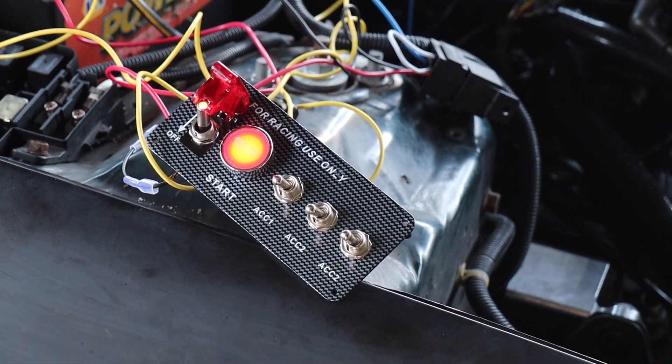I got all the lights to work when I put the switch on, but other than that I have no clue what I'm doing still. I'm trying to wire it directly to the starter but I can't get it to start - this is definitely above my pay grade. I could completely wire this inside the car and tap into wires, and that probably would make it a lot easier. After some perseverance, I figured it out. All we had to do was ground the black wire on the relay, put the blue wire to the post in the plug, and press the button and it starts up.